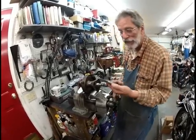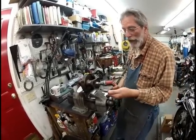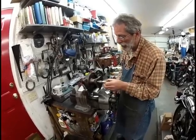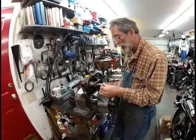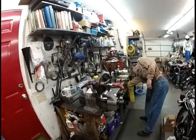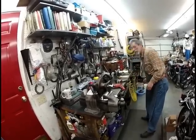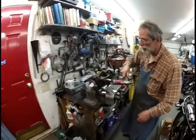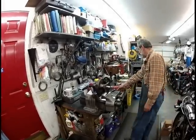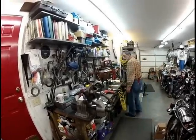You take one of these. Okay, this is an easy out, pretty big one. You buy it at the hardware store. It'll set you back probably 25 bucks. It's worth it. Right? So what if you're only doing one? Get that located in there. Okay? And grab yourself a medium ball peen and smash it in there. Okay? Pretty simple shit. Okay? If I can do it, anybody can do it.